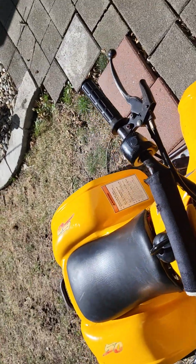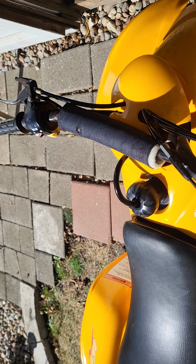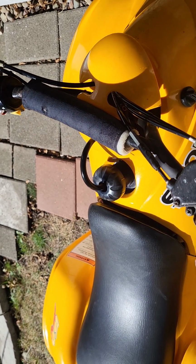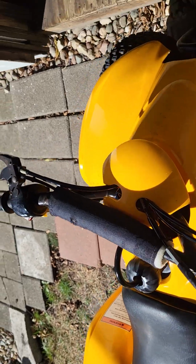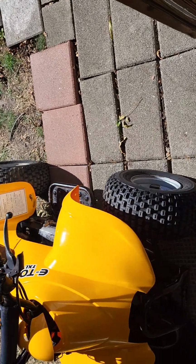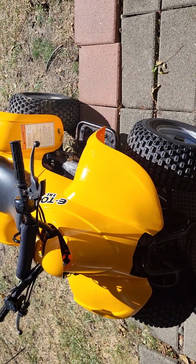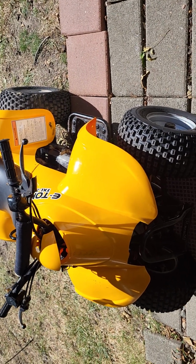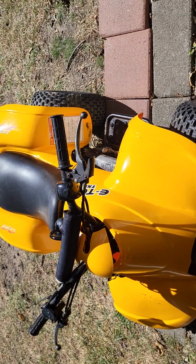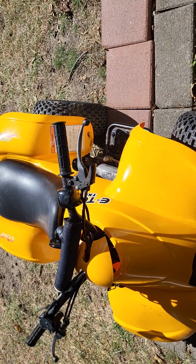But you can find these pretty cheap. Generally, what I do, I get them home, unhook the battery, hook up my booster box because the battery's probably already dead, and spray some starting fluid directly into the carburetor. If it fires, you know you got spark, and then from there it's a fuel issue. Carburetor, they won't run perfect. You may have to tinker with the idle, and you'll hear that one just died. But they're for riding, not sitting there listening to them idle.